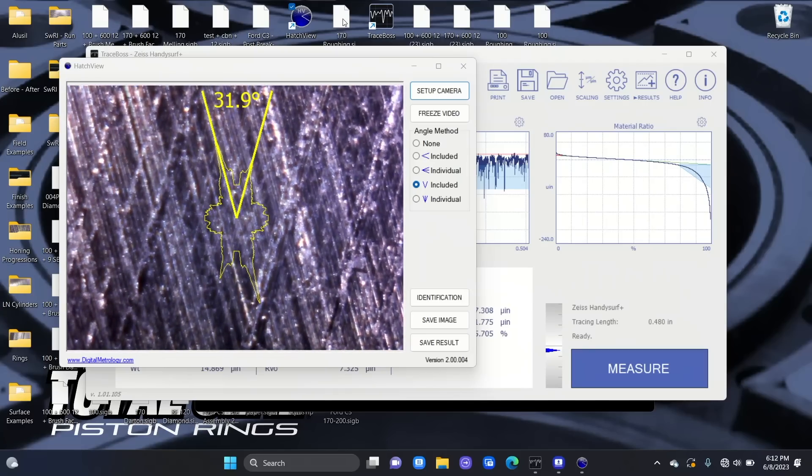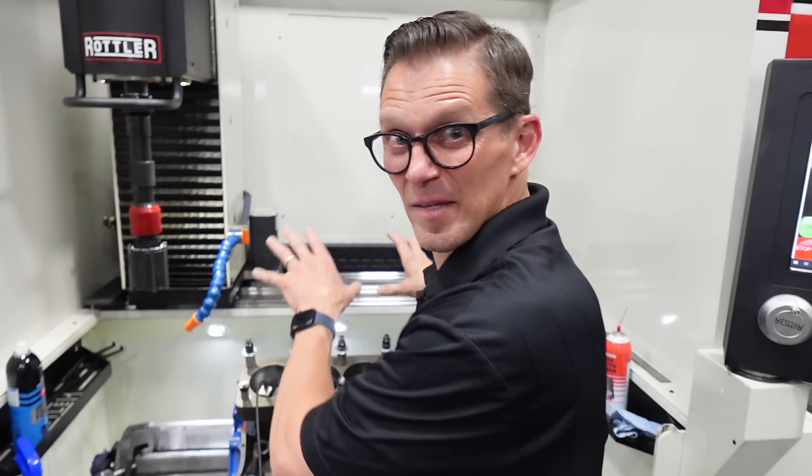I think it's actually better than before, so I'm kind of glad we scuffed it because now we're going to go get three new pistons coming in, and we're going to put the line-to-line coating — five thousandths clearance skirt coating on all the pistons. Then it will self-fit itself. So we were able to go three thou over, save five pistons, line-to-line, put it together.